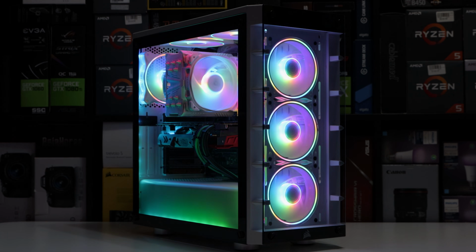But the fans themselves, in the positives, these fans are straight beasts. They go up to 1800 RPM. You can put them all the way down to 650. You can play with the fan curves and all that. And when the fans run at like 1400 RPM, even at 15, they're decently quiet. You don't hear any mechanical sounds, as with some of these cheap Chinese RGB fans, but you don't get none of that.